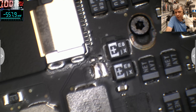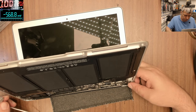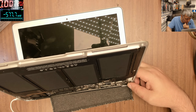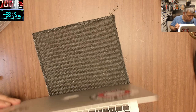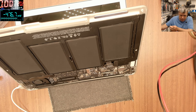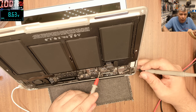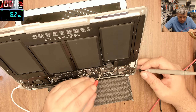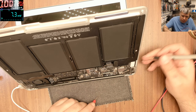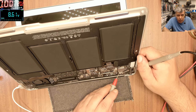Okay, let's start checking some things. Most likely some voltages are present. Let's take out the battery. Now with the battery out, the board is not coming on. Let's take the multimeter and check some voltages. We're getting 8.6V — that's about right. I can bet the 3.3V is present too. Yes, 3.4V — that's okay, that's good. 8.6V confirmed.